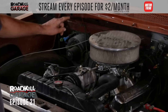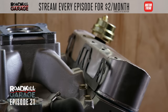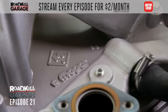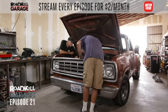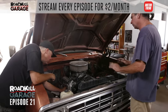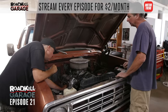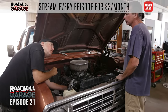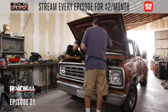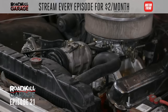To keep it on the road I put in this 318 temporarily, but at 400 horsepower I can't really call this a muscle truck. So I've got a 550-horsepower 408 — the 318 is coming out and the 408 is going in. The 318 is a 40-over block with a KB 167 flat-top piston giving about 10.5-to-1 compression. It's got a Comp XC 268 cam — 224/230 at .050, 477/480 lift on a 110 lobe separation. A nice hydraulic flat-tappet street cam. The intake is a Performer, ported out to match the larger port size of the 360 heads.